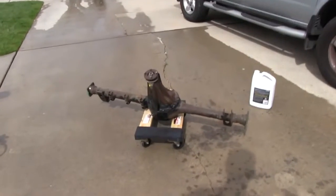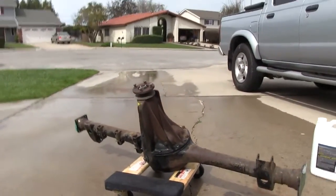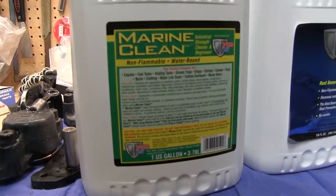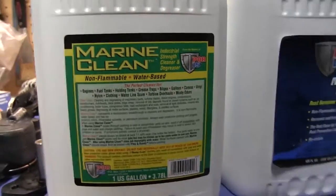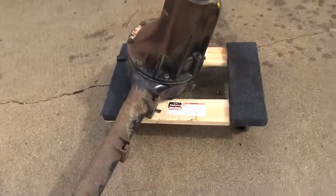The differential just needs a nice coat of POR-15 gloss black — doesn't need to be disassembled. The differential is tight as can be. And once I put a liter of gear oil in there it'll be good to go. Last time I worked on the differential I used acetone. I had POR-15's Marine Clean on order, wasn't here yet, but I needed to get something done on the car — couldn't just sit idle waiting.